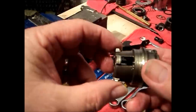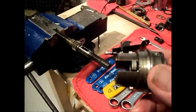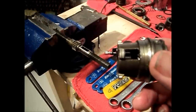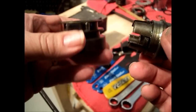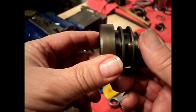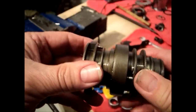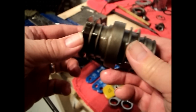When we change gears, what we're doing is changing the position of the clutch within the hub. In first gear, the clutch is pulled all the way back. In second gear it's in the middle position. In third gear it's in the forward position. In the first two positions, the clutch is actually driving the ring gear, so the power flow goes from the ring gear to the planetary. When the input is the ring gear and the output is the planetary, and the reactionary is the sun gear, the result is a gear reduction or underdrive.